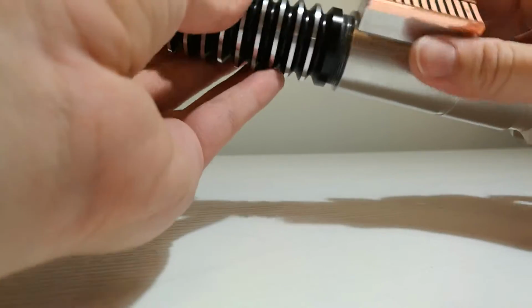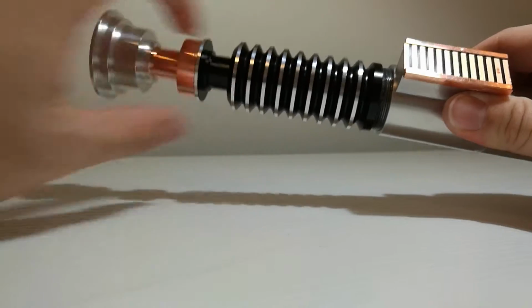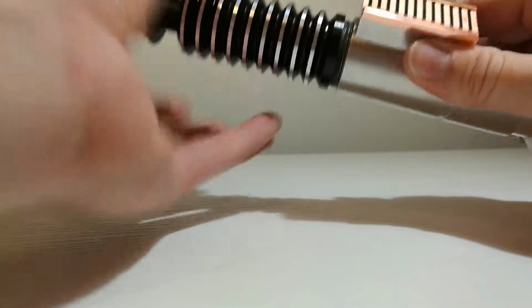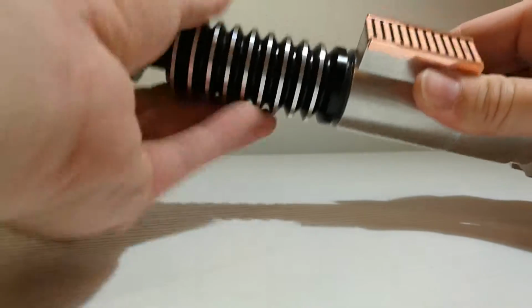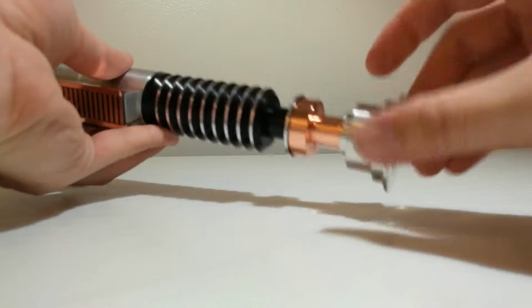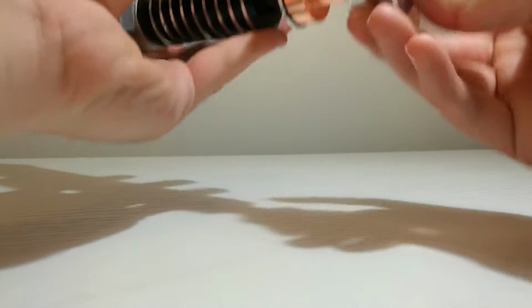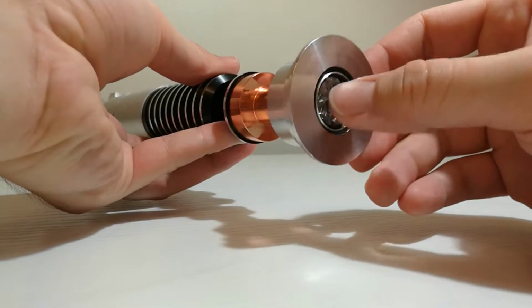There's quite a long redundant wire in here to buffer the twisting motion, but sometimes when you repeat it too many times, you'll see it gets to the emitter up here. You see that's kind of loose. You can always retighten it. You see the LED module? Just retighten it.